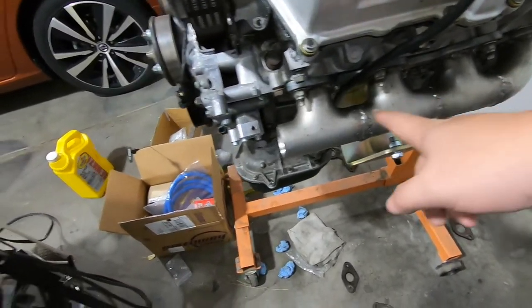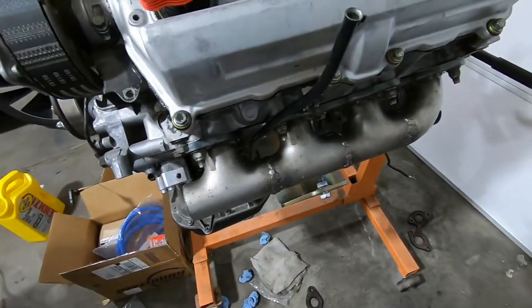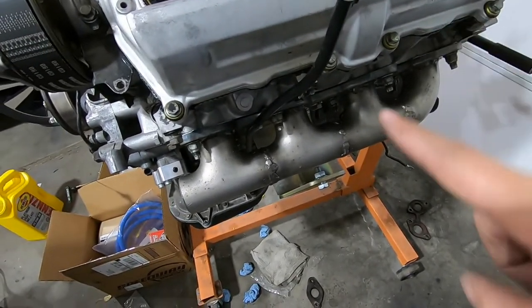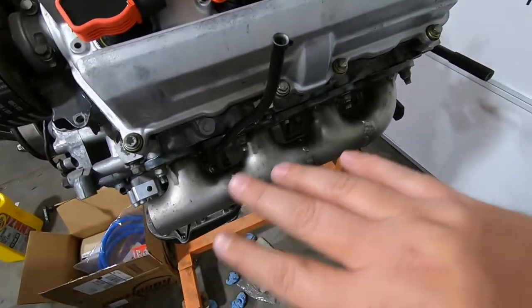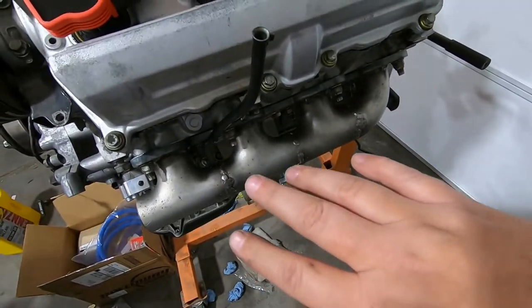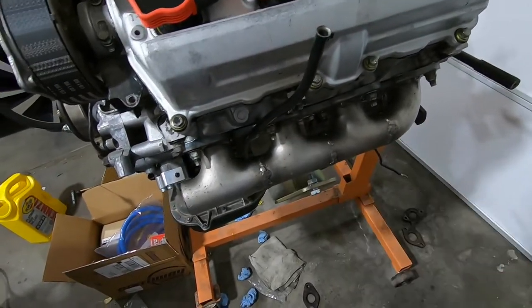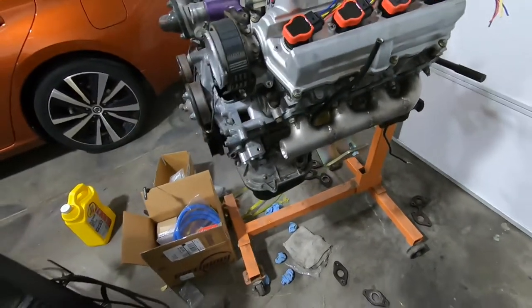Here we are, finished by my standards. We now have the dipstick tube bent out, not touching but getting close to a number of things. It is not touching the tubes, so I feel better about it. I'll find out way down the line if it's good enough. Here's my lovely log manifold — it should function. I believe I have every pinhole sealed up, and there are extra goober welds on it to make sure. That's what we have. I appreciate you watching. Have a good day, bye.